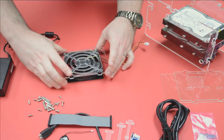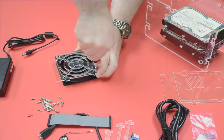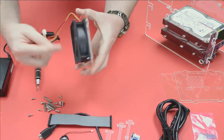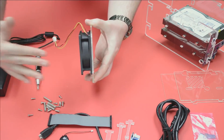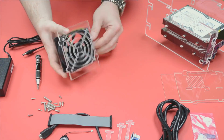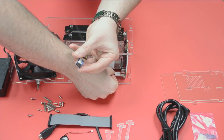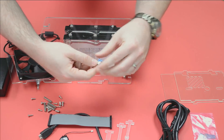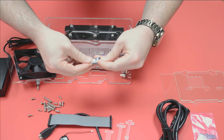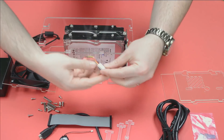This is the 92mm fan — I'm just going to mount that here with three screws. When putting the fan on, we observe the airflow direction: there's a little arrow showing it's blowing out the back of the computer. We want to draw hot air out of the chassis. It also includes a current limiter, which will slow down the fan and make it quieter. I'd recommend installing that first and then monitoring temperatures.